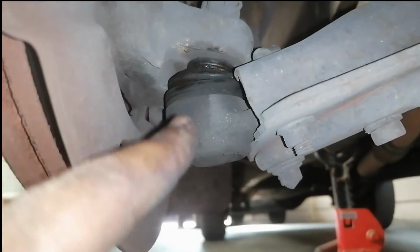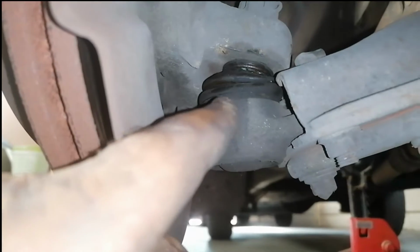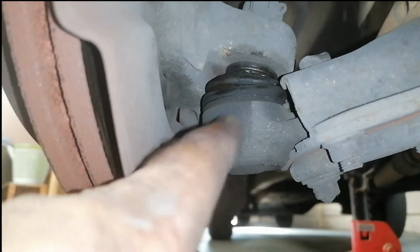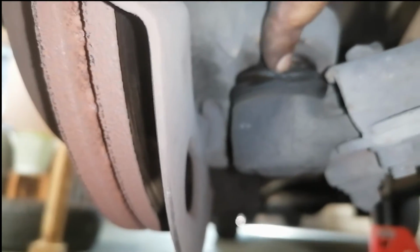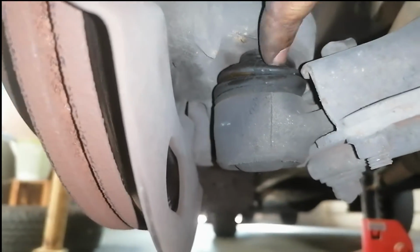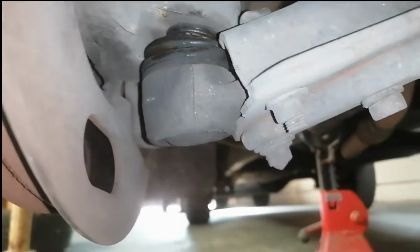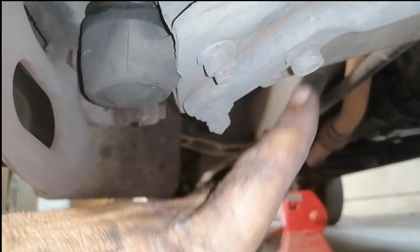So there you can see the reason why I want to take this driver side one off, because as I showed you early on, this is quite wet, and this rubber seal is quite hard and perished on top there. So in order to loosen this, I'll have to take these two, here's 4 nuts and bolts here underneath here.